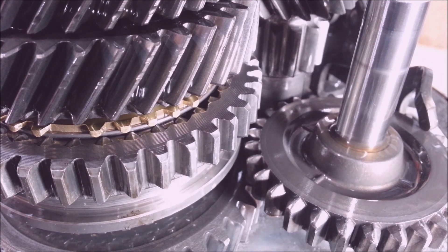The reason they get like that is because people don't know how to use a transmission. I don't speed shift, I don't muscle things into gears — I let synchronizers slow the gear down like it's supposed to. These look really good. I don't see a point in changing out these synchronizers. The way I use a transmission, this thing will probably be good for a long time. If it don't want to go into gear, I don't put it in gear. Speed shifting kills transmissions.